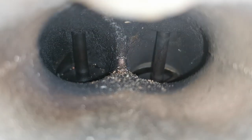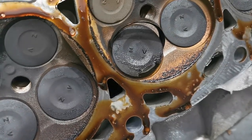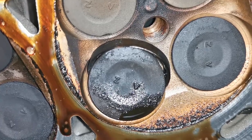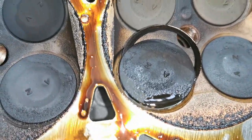After the test I was able to tell the customer directly that they had an issue with the intake valve not seating. We didn't know exactly why yet and would need to investigate further, but I was able to give them an idea of the quote based on what we found. The customer gave the go ahead, and when we had the manifold off and looked at the back of the valves we could see the intake valve was not seated correctly — the diagnosis was 100% accurate. We were able to confirm that on removal and show the customer exactly what went wrong. That is the complete process for a cylinder leak down test, and following it will give you a very accurate result to pinpoint the root cause of what's going on in the engine.